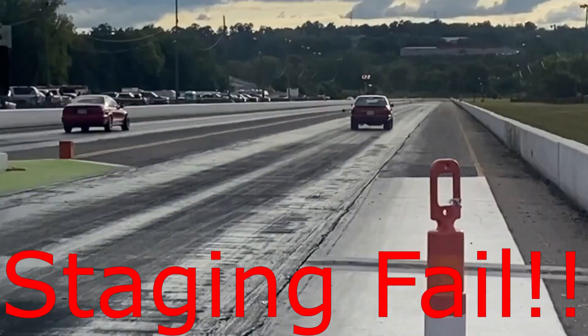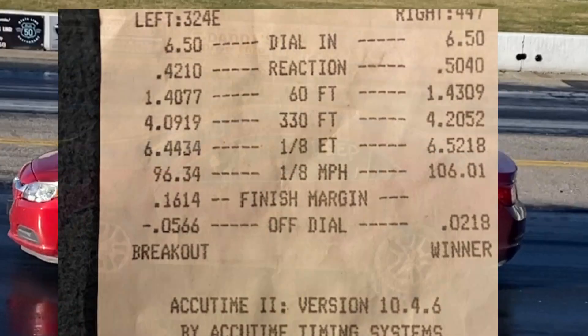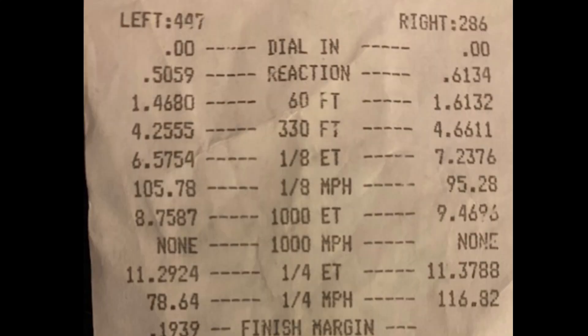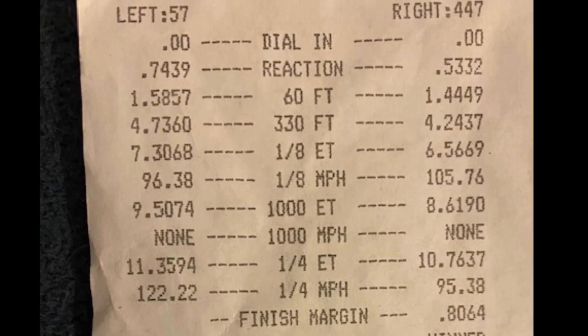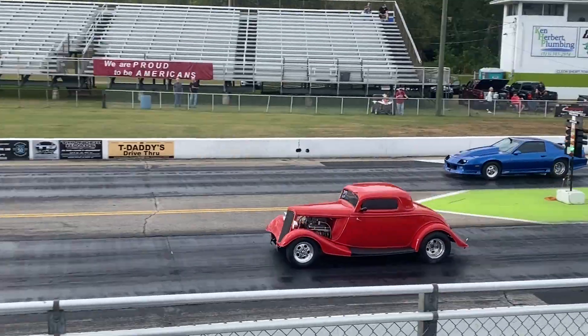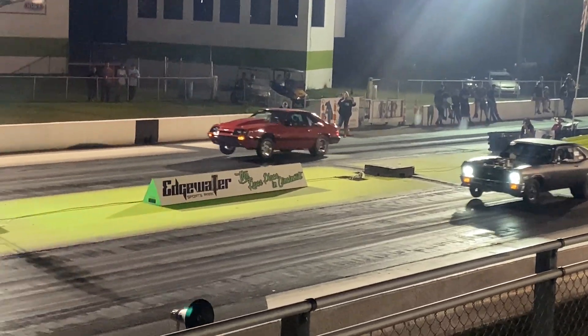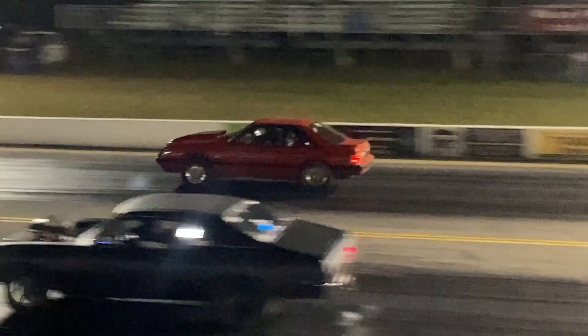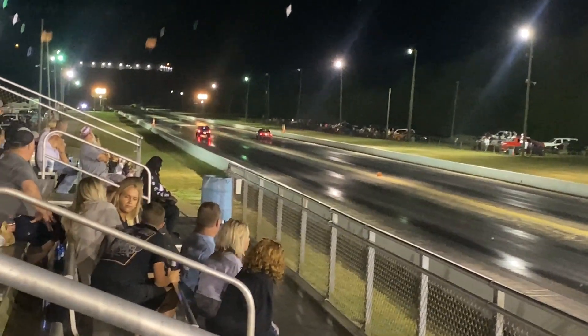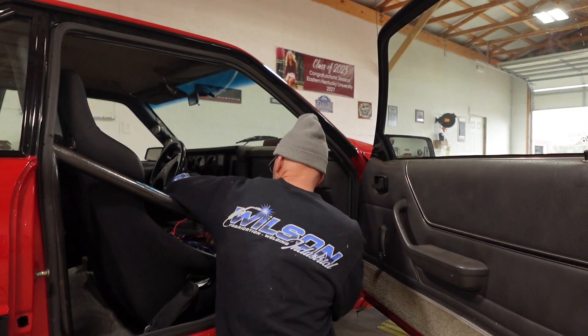One more caveat: deep staging is sometimes allowed but certainly not honored. My best reaction times were in the high 480s to low 510s, with the car being about 280 of the reaction time and me being somewhere between 190 and 220 depending on the day. Research I've done says that a well-set-up car and a great driver can go red on a 400 tree. So if I encounter someone like that, they immediately have a tenth on me, resulting in almost certain elimination. Anyway, back to the question: why are we going to add a bump box to a naturally aspirated index car?